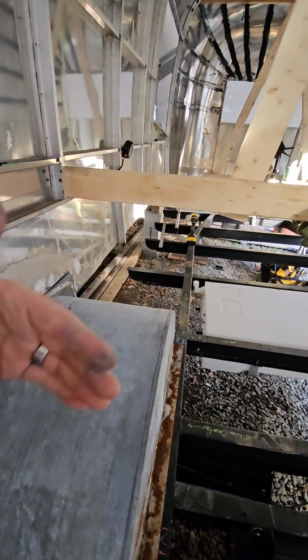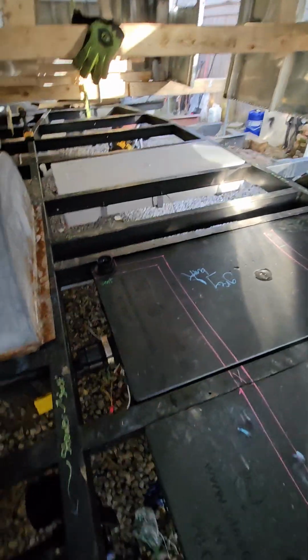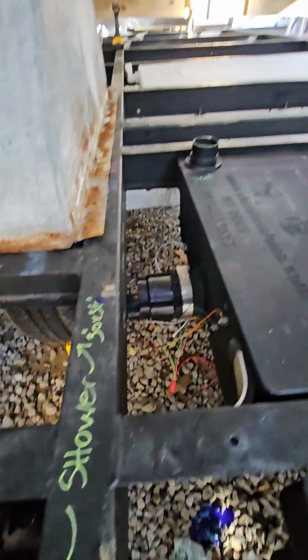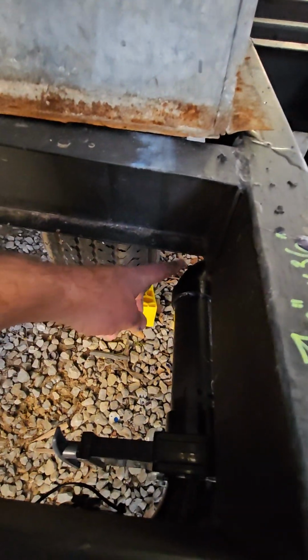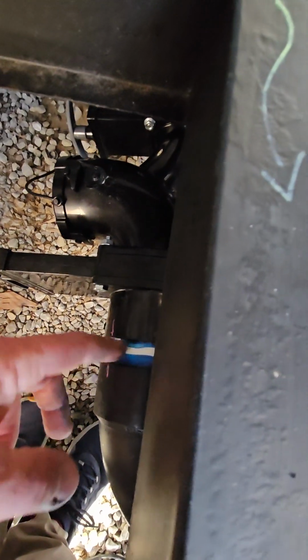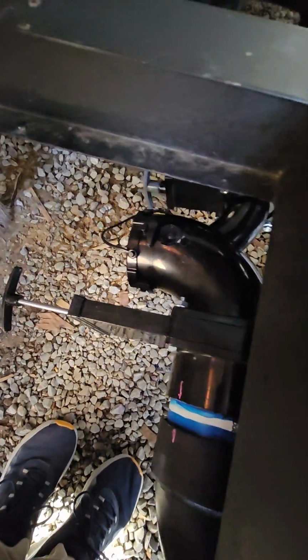And this will start the kitchen cabinet, so here forward will just be an open space. So I think that'll work fine. I also got the, I'm not going to get down there. I got the primary drain dump valves mounted. So that meant plumbing is 3-inch with a 1.5-inch, and then a 90, 1.5-inch into the gray vent, or dump rather. And then same thing over here, 3-inch, 90, a small section of 3-inch pipe connected into this side, and of course that'll dump. That all worked out pretty well.